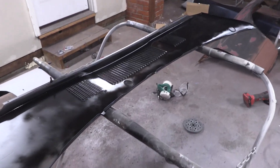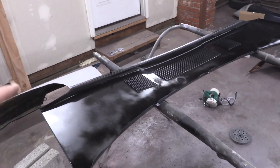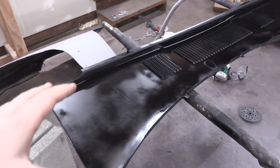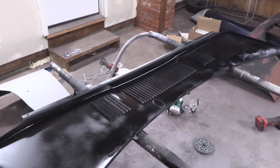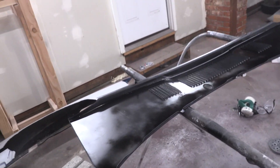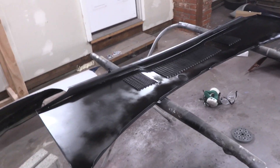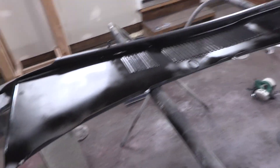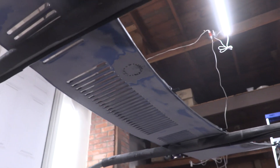The cowl is ready for body filler now. The bottom side is done - what we're doing with a few panels is that on the backside they get flat black. It looks crappy and splotchy right now because it hasn't dried yet, but once it dries it'll be consistent flat black. That's to kind of hide the panel - we have a tube frame chassis so you might see the panel from underneath at a weird angle. If somebody sees up from underneath we want the panel to just look black, like there's nothing there. The back trim piece and bottom piece are black, then everywhere else gets primered, sanded down, and wrapped. We just need to do body filler on that spot, so let's head inside and see how they're doing.